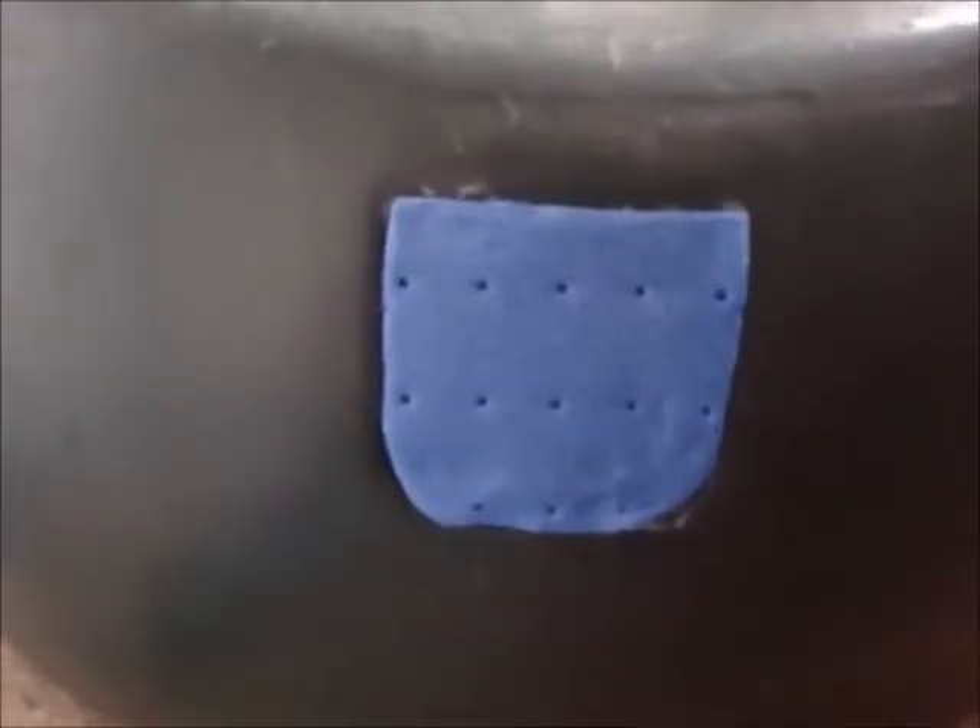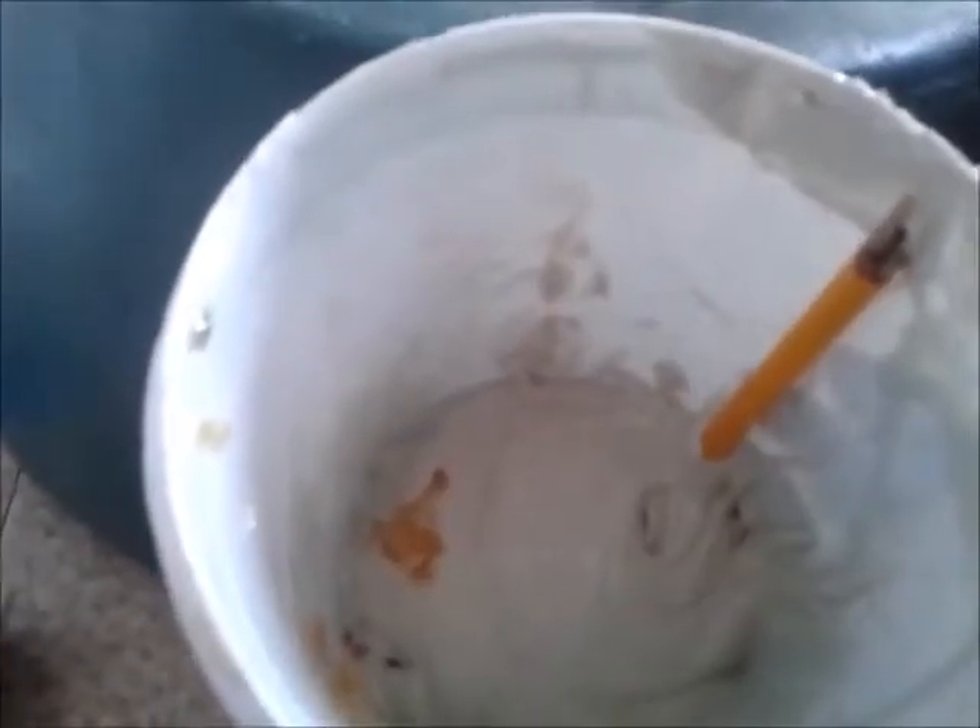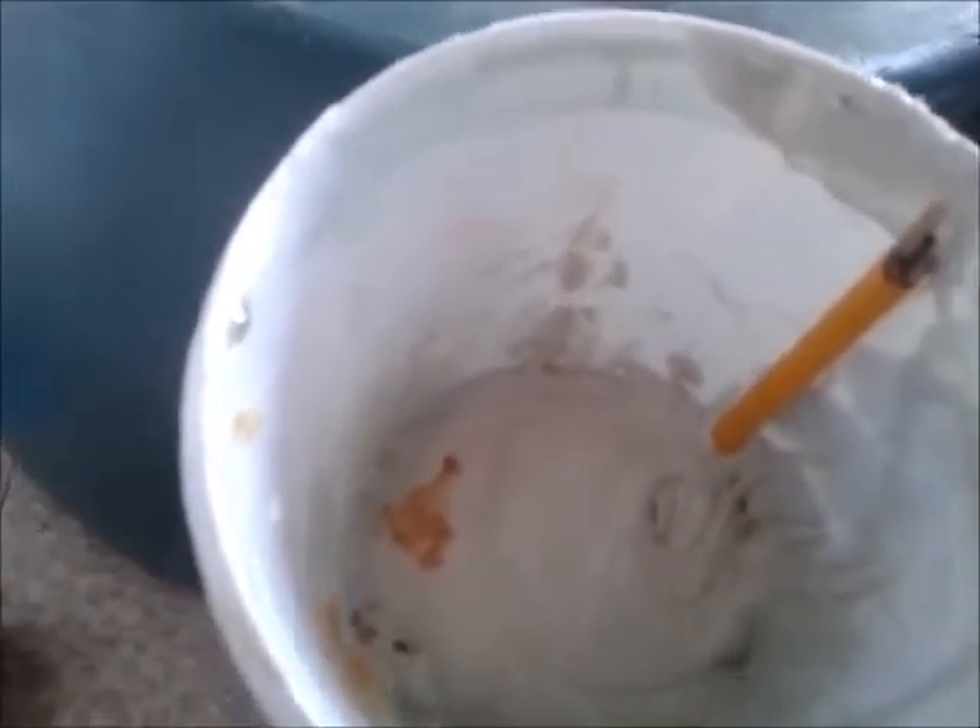So I've hot glued the polystyrene into the gap there, and now I'm going to put some cold body filler thinned down with resin — I'll get it right — and coat it with that and see how I get on. So I've coated over it now, we'll let it set, might need another skim. We'll sand it down and see how far I get.